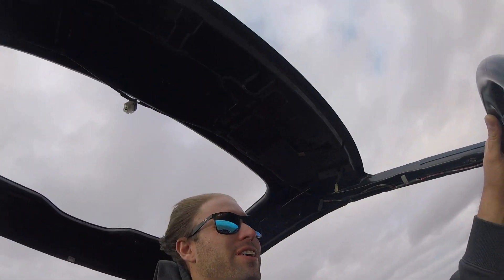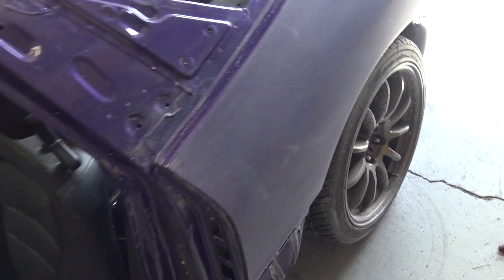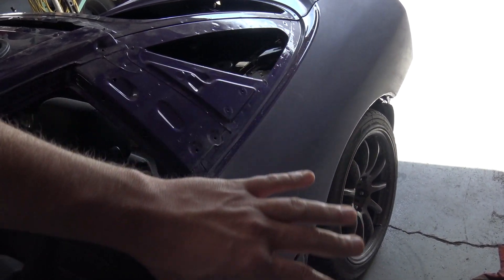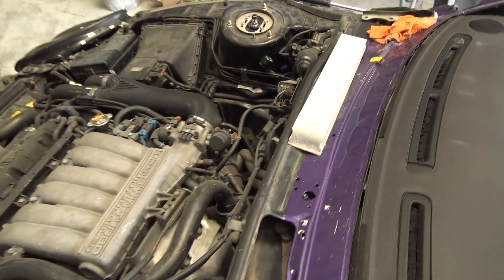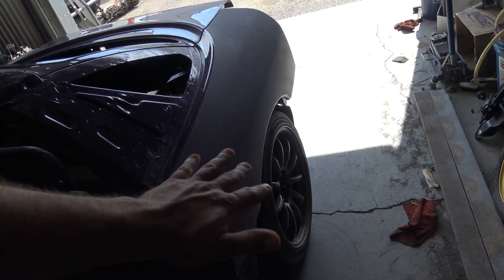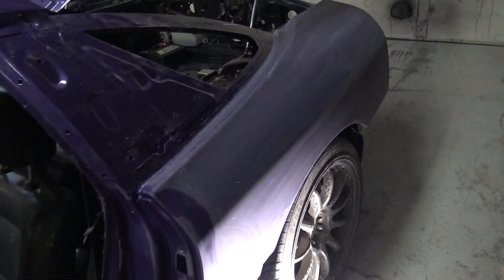Last night I got these quarter panels blocked out in 600 grit. I'm going to go back over them with 800 now that they're smooth and I've got all the runs out. I used the long — I think it's a 24-inch block right there — instead of a smaller block, because a smaller block would have had the chances of being wavy. I've been sanding the quarter panel and I also got into this area.